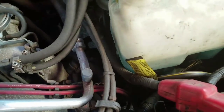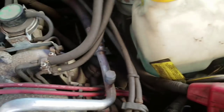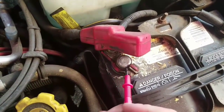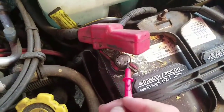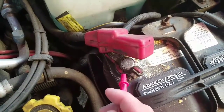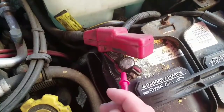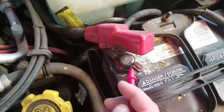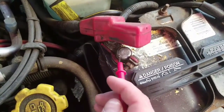So between here, that tells us that where this, move your hand for 1 second. So you see how this wraps around? Yeah. This right here will wrap around the outside of the battery terminal. That means that between here, see where I'm tapping? Here and the outside piece that actually wraps around it, we have no corrosion in the middle, nothing at all that's preventing us without losing any voltage here.